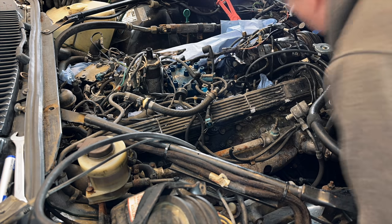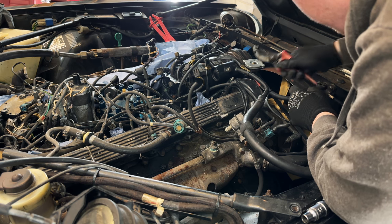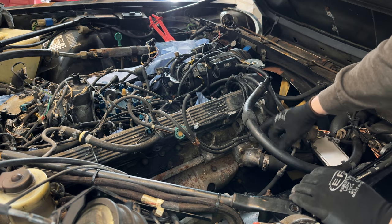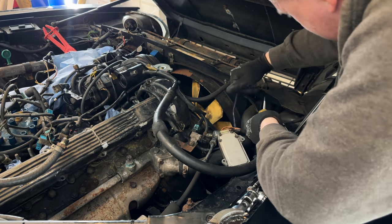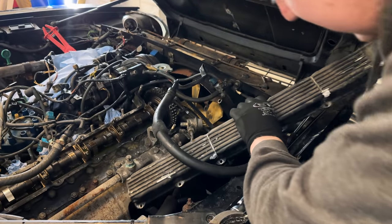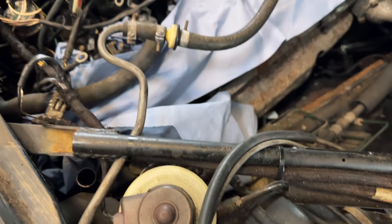Last bolts out of the front of the unit. This bracket here comes from the front of the camshaft cover. Cutting off the coolant pipe zip ties I put on in a previous video gave the pipe a slight give but it wasn't enough. Fuel pressure regulator out the way. Loosening this bolt here allows the part to swing out of the way. Sensor here is taken off. Tuck the wiring around the front of the cam cover. This electrical connector then separates, zip ties cut, wire taken out of the way of the cam cover - and off it comes. Revealing the suspected source of the leak: the rubber half moon gasket which shrinks and dries up over time.